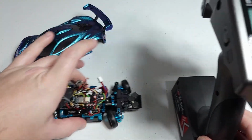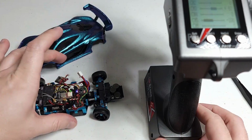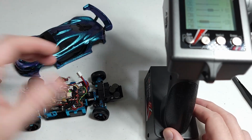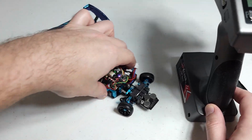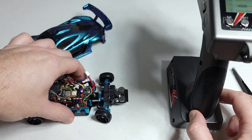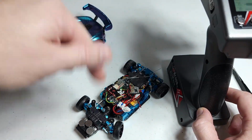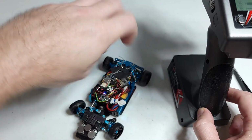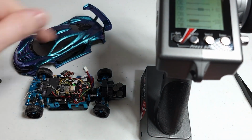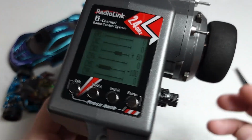It's a little bit harder to drive though, because it's slightly unstable in a way where it's not really smooth when you have it down that low. Or I guess, for this car, 60% is almost kind of low. So when I have it closer to 70, 80%, it'll give me much smoother, bigger drifts. And like I said, if I have it down in the 60s or lower, it'll give me really tight, less smooth drifts, but I can do really tight donuts and stuff. So it really depends on what style of driving you're gonna do. Sometimes I'll keep it low in the 60s if I wanna do really tight little circles. And then if I wanna do smoother, bigger drifts, I will bump it up into the 70s.